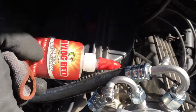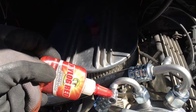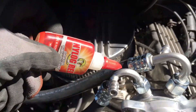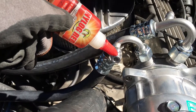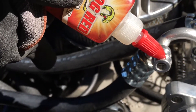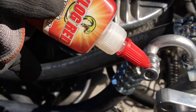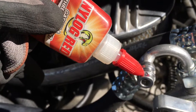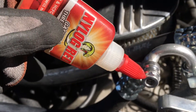I don't remember if I've ever made a video of this, but whether it's the silicone grease, spark plug blue grease, or something like Nylog red, Nylog blue — this little area right here, now watch this. That little area right there, that is the area where your O-ring inside your R134 fitting seals, only right there.